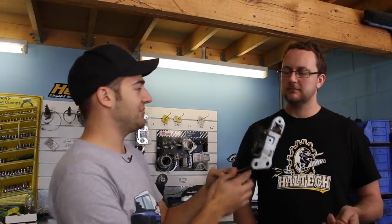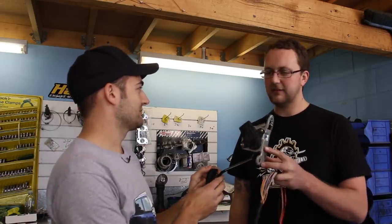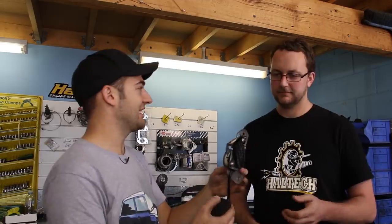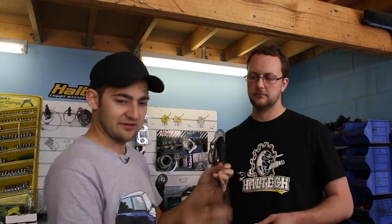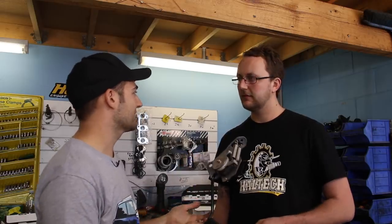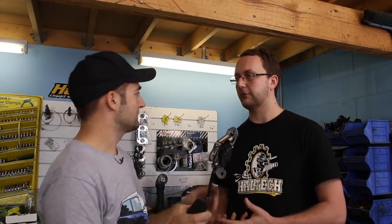This is an APP - a pedal position sensor, not an e-throttle. E-throttle is the other part - technically the throttle is the bit with the blade in it. We put this in a few episodes ago; now we're at the point where we're going to be wiring it in. What's special about what we're doing with the Haltech is that for a long time you couldn't do e-throttle on an aftermarket ECU generally. Now we can mix whatever pedal position sensor with whatever throttle body you want - so you could get a Subaru pedal and run a Ford BA Falcon throttle blade. GM ones are really popular because they're reasonably priced 100mm throttle bodies.